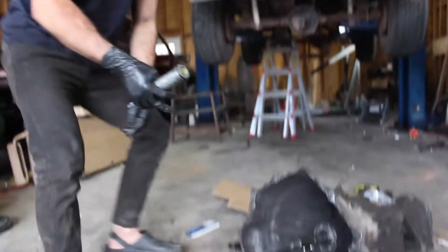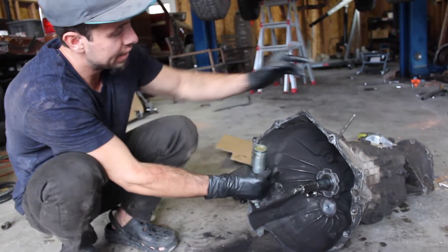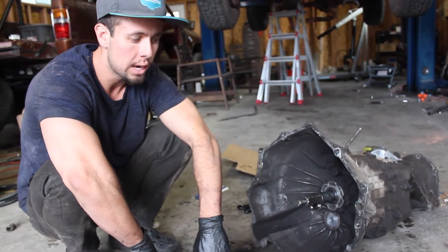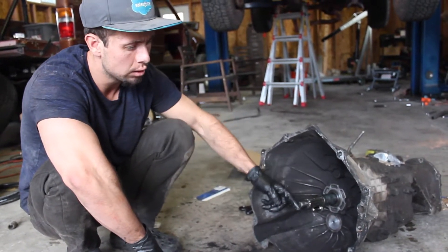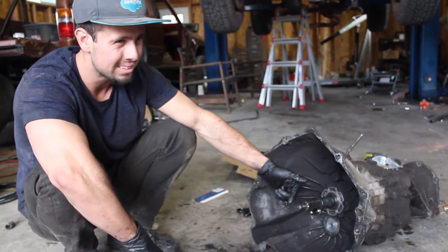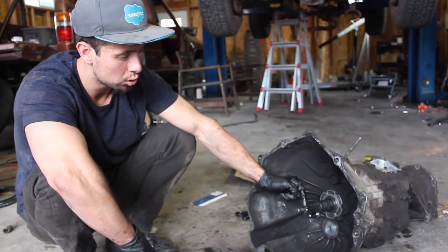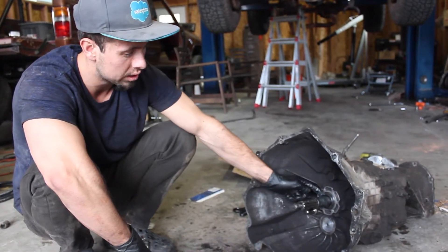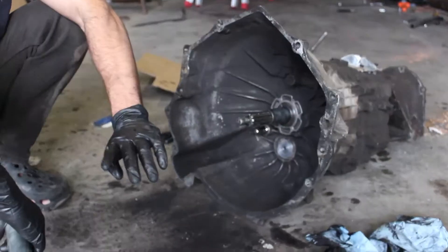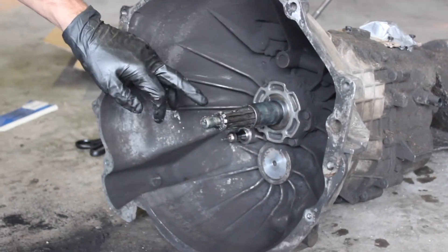This is the earlier version of the NV3500, pulled from an '89 GMC. What you're looking for is the spline count on the input shaft - I think it's 27, 31, or maybe 32; you can double check on Novak Transmission guides. I counted the shafts and they line up. I measured the input shaft - it sticks out about six and a quarter to six and a half inches from the base, about an inch wide, about an inch long, then about two and a quarter. The throwout bearings from the SM465 and this one are basically almost identical.